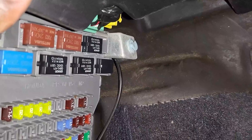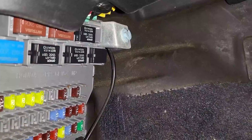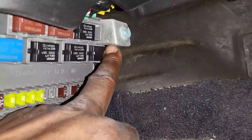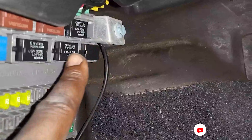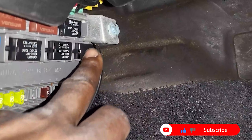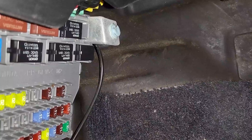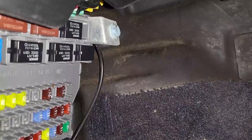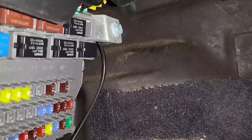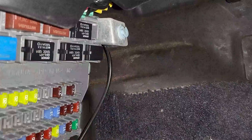You see here, there is a top row and a bottom row. From the bottom, the first one on the right side is blue. The relays here have numbers, but this first one doesn't have a number — this is the relay for the starter. Before you have any problem, like the car doesn't want to crank, instead of removing that intake manifold and fighting with it, just come inside, take this one out, and put another one in.